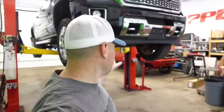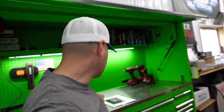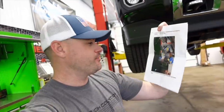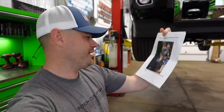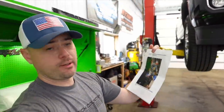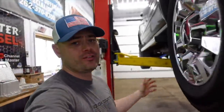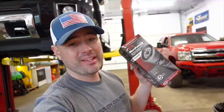Now that we're back, I'm going to go ahead and install this. I've never done this before so I'm excited to protect my investment. Thank God Ryan sent me really detailed highlighted instructions — I shouldn't have any problems. I'm going to drain the trans fluid now. I will not be replacing the trans fluid since it's already been serviced and is still good. I'm also pumped to install this high-capacity PPE oil filter — I actually sell these on my website, truckmasterdiesel.com.